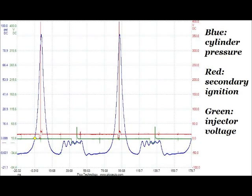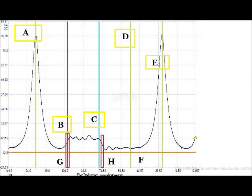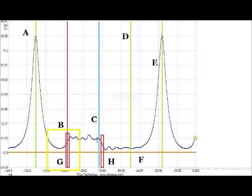But it is the running pattern that holds the real value. Here's one example of a known good running pressure pattern. By adding the same cylinder's ignition signal to the scope capture, I can tell if ignition timing is correct. A few scopes have the ability to lay out the piston's travel in the pattern for easy reference — I use Windows Paint program to do the same. A is TDC compression. The piston then moves down to B, or bottom dead center of the power stroke, then begins its rise to C, or top dead center of the exhaust stroke. Next comes D, or bottom dead center of the intake stroke, ending at E, TDC of the next compression stroke.